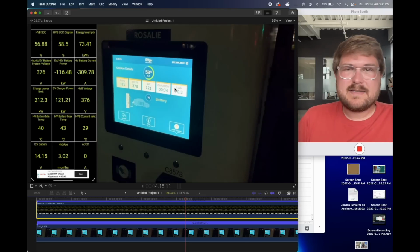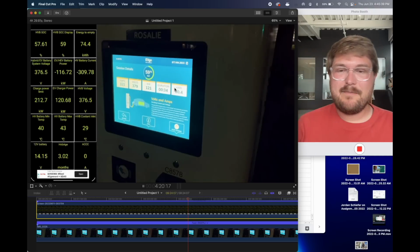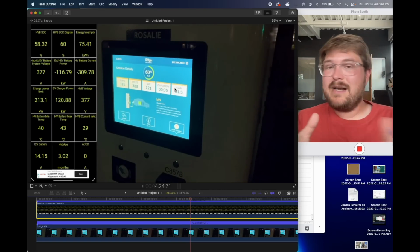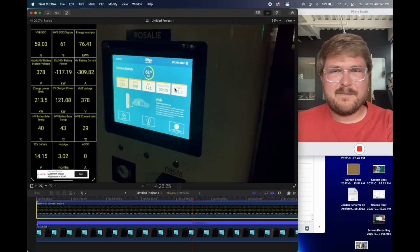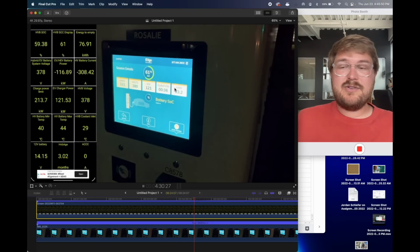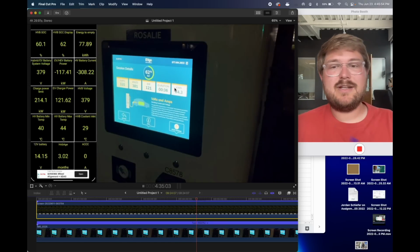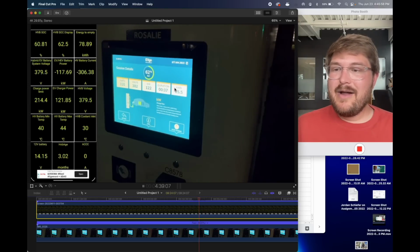This is probably the weakest part of the charging curve, just this mid-section once you come off your 10-minute peak. Now, that being said, there's not much benefit to running this truck to 0 when fast charging. Actually, probably not beneficial at all. The best thing to do is probably target a 10 to 15% arrival to the next station and ride that peak when you have a little bit more pack voltage in there.